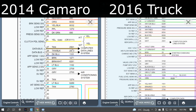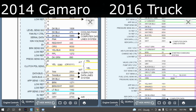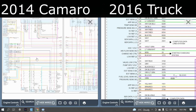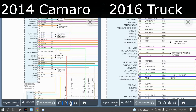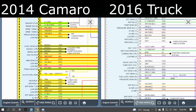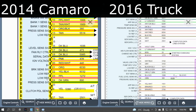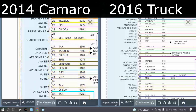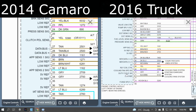For the data bus — a very important one — we find the same identifier 2501 on both sides. Different wire colors, different pin positions, but same identifier. You take that out of the car ECM connector and put it into the right position on the truck ECM connector. To wire the truck ECM into the car, that's all I did: moved every single wire over one at a time. It's really cool because the truck and car share the same Molex connector on the ECM due to the same electrical architecture.